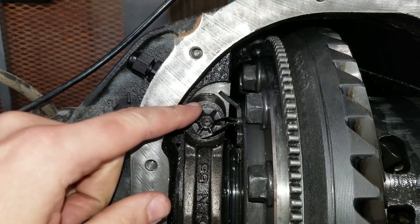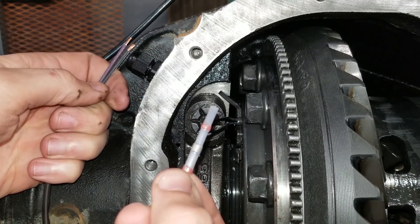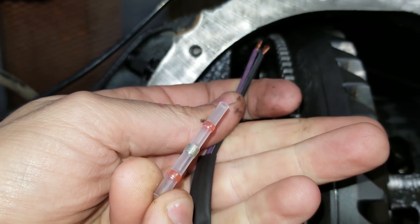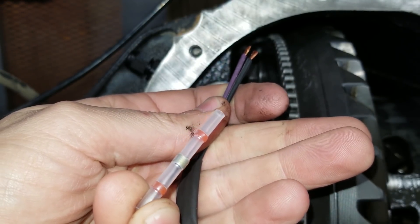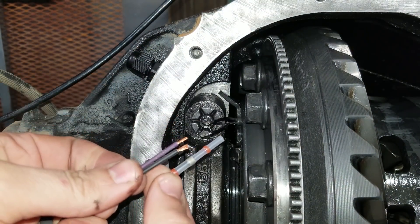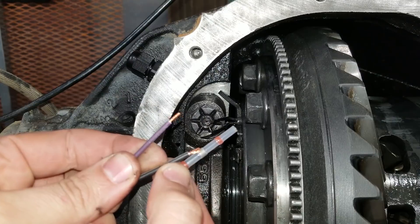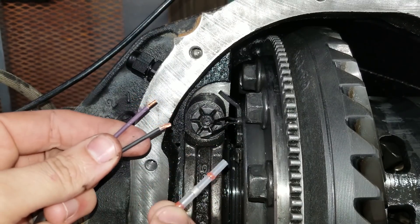Leave enough slack — you don't want those wires getting tugged on when this locker actuates back and forth. To connect my new wires to the existing wires, I'm going to be using these solder seal connectors. I've never used them before, but basically it's heat shrink tubing. The little red band is adhesive that glues itself to the insulation, and in the center it has some low temperature solder that when you hit it with a heat gun and shrink all this stuff together, it'll actually wet and solder the two wires together for a good connection — in theory.